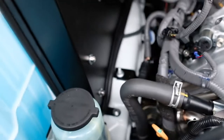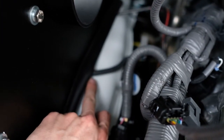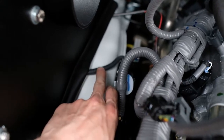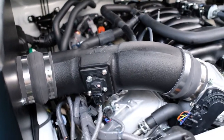There's a third one right there. I left a lot of these loose and then tightened them back up with a wrench on the other end for the nut. I also went ahead and put this on - I see a lot of people don't put that on, but I wanted to just for comfort. If you look down here it's resting right up against that wire, which could potentially cut that wire, so you want to put these little rubber inserts on.